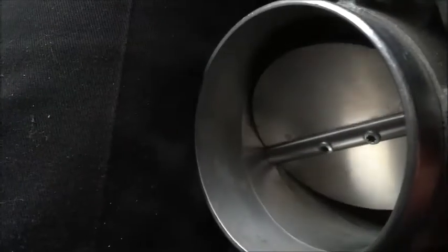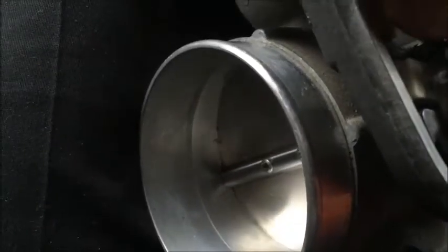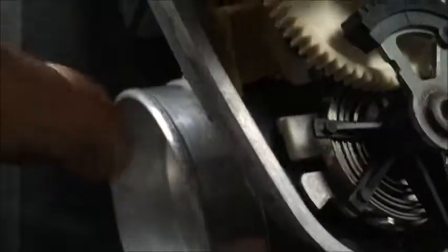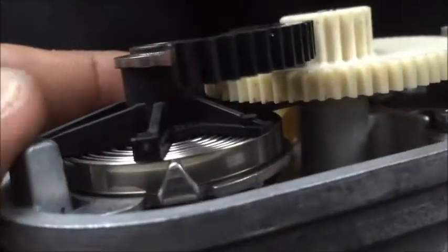I wanted to show the insides of these drive-by-wire throttle bodies. What I found was this throttle sticks open because of the idle RPM. What happens is this is the open position, but to get it to close that extra little bit it pushes against this stop here underneath — this little arm hits against that black arm which is under there.